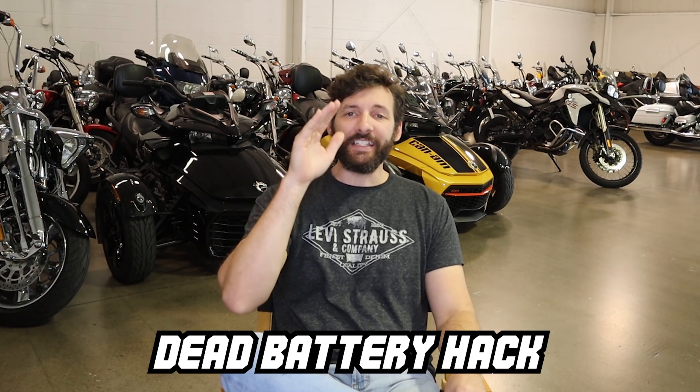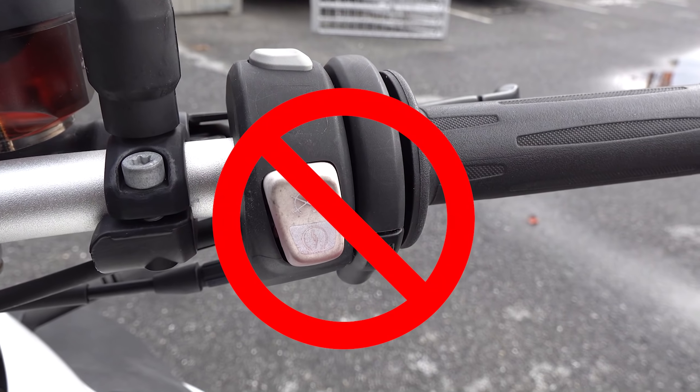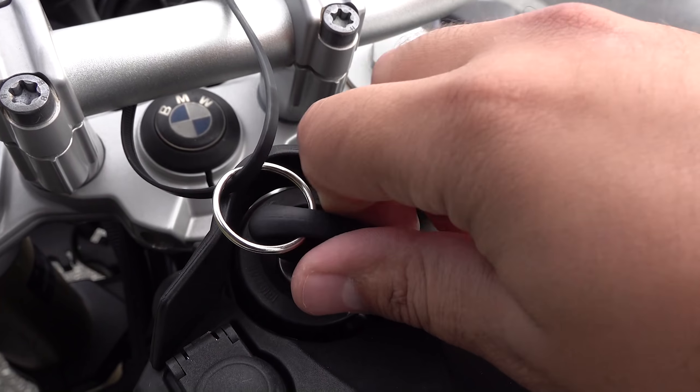This is something a lot of new riders do, and it may be controversial. A lot of new riders — and if you're like me — you probably leave your keys in your bike almost all the time. I never use my kill switch to turn my bike off, because what ends up happening is I pull up, use the kill switch, start chatting with someone, step off, walk away from the bike, and I've left the lights on, left everything else on, and the keys in the bike. When I come back, my battery's dead. Never use the kill switch — always use the ignition. Turn the ignition off, your lights are off, your battery's going to be preserved, you can come back and fire it up. It saved me so many times.